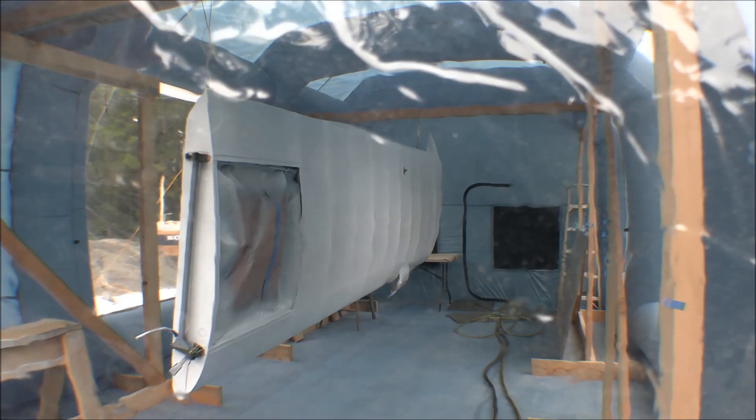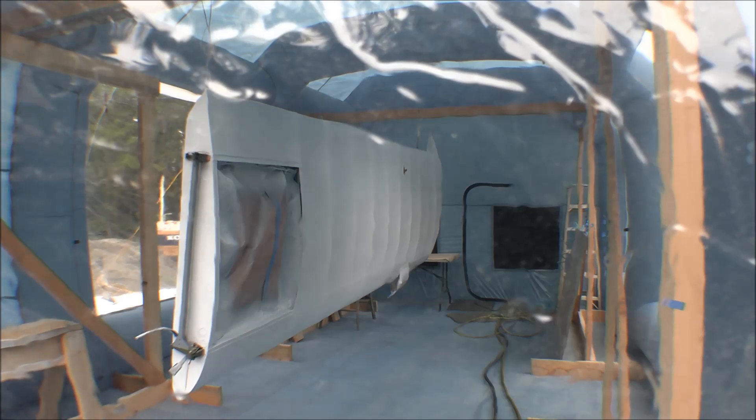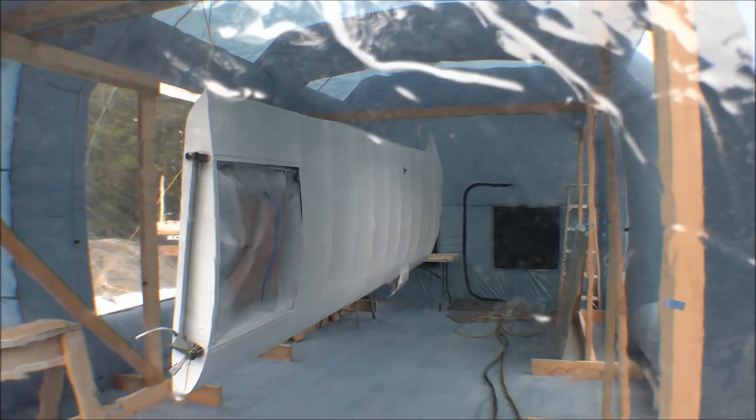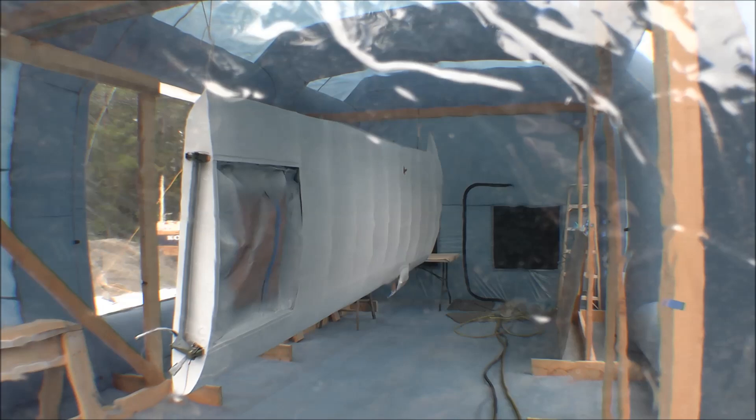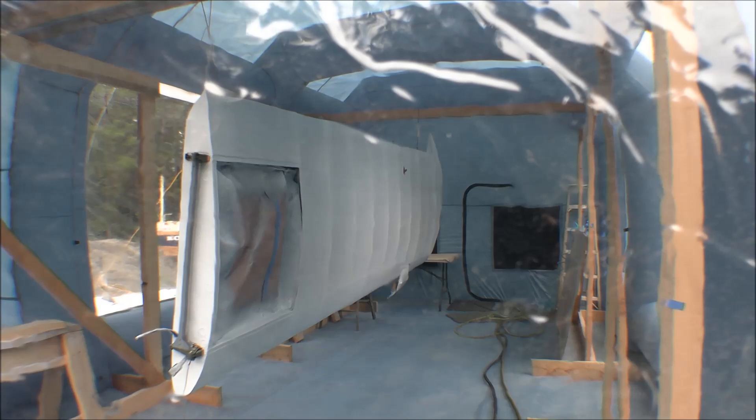Now I'm going to mop the floor and get it wet so we don't get anything coming up off the floor, then take a tack cloth and go over the wing, mix my paint up, and start spraying. It's later in the day than when I was spraying the poly stuff because I wanted to spray it when it was cool. This regular paint doesn't matter if it's cool or not - in fact it's better if it's 70 degrees plus. It's less than 60 degrees outside today, but nice and warm in there with that greenhouse effect inside the paint booth. The weather here today goes from clear blue sky one minute to pouring down rain the next. It's starting to rain right now, so I can't leave the camera out here to video any of this process.